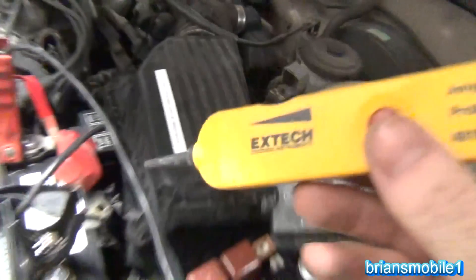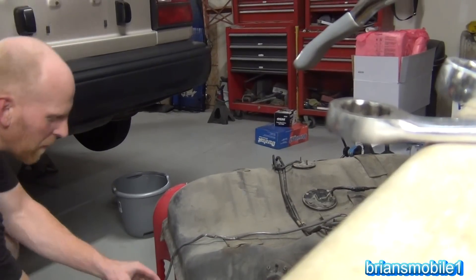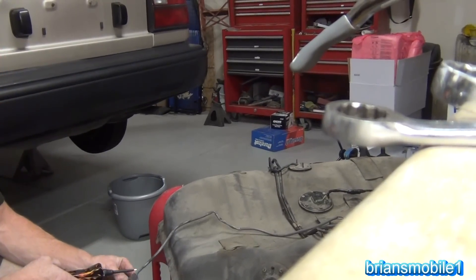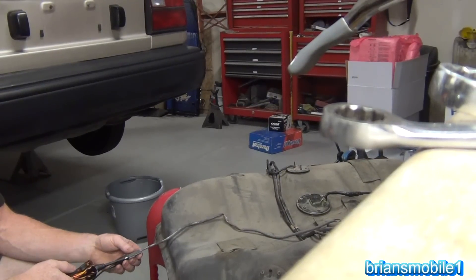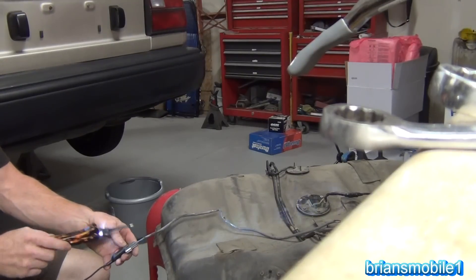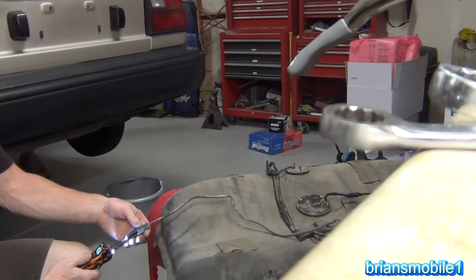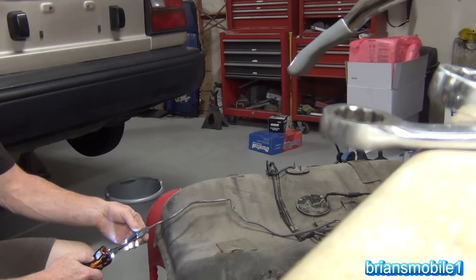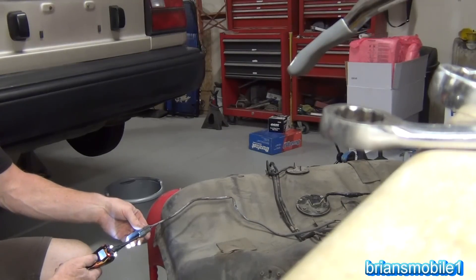What a fun tool, but it was still a pain in the neck to find because of the remote location. Somebody else wants to see the fuel pump run, so we'll do that. Your blue-and-black wire is the positive, your white wire is the negative. I'm just using my power probe - it's supplying ground to the white wire and I apply power to this wire. Turn the sound off and you'll see it light up; you can hear the fuel running into the gas can.